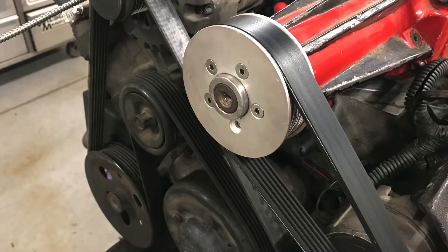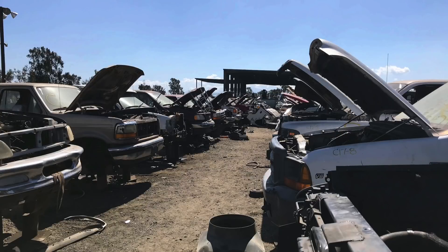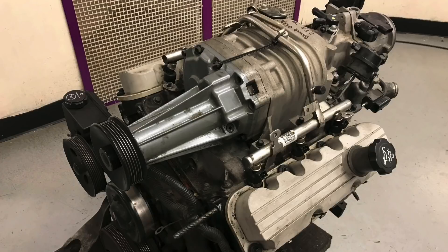I wasn't able to do that before. So we have a lot of other tests — I have blower pulleys all the way down to three inches and we're going to go even lower later on. I can do water meth injection, we're going to put the comp cam back in, we can do a lot of cool testing. One of the things I want to do if this motor is a runner is go to the wrecking yard and gather up a bunch of NA intake manifolds. You might be asking yourself: why would you want to put NA intake manifolds on a supercharged L67 motor? The reason is because I want to test a bunch of the intake manifolds without the blower — because we're going to add a turbo.